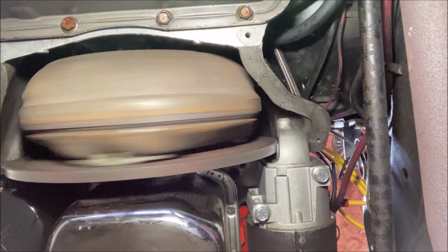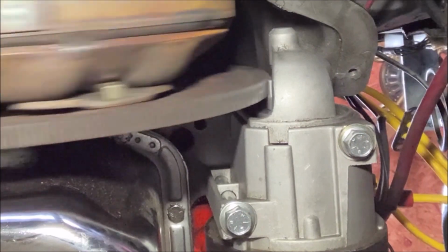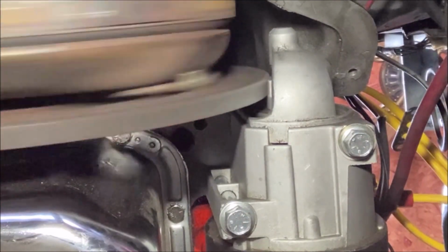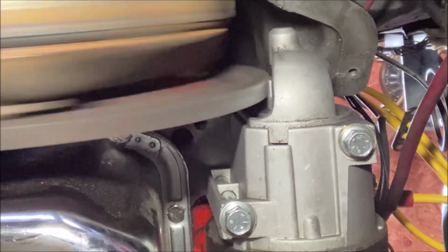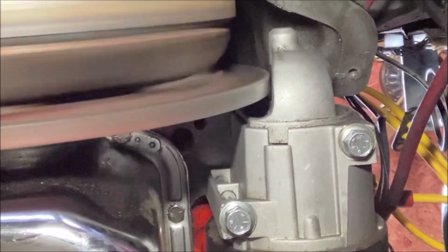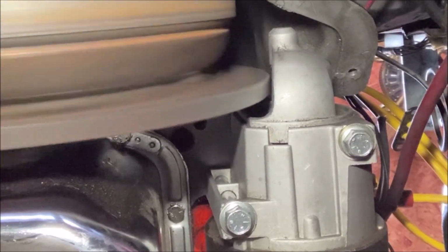So after a couple of really hard hits, check out the run out on this flex plate and leave a comment down below if you think that plate is wobbling just a little too much. I have a fresh set of starter bolts on order and we'll see if that helps any. I'm going to drive it and see if I feel any vibrations.